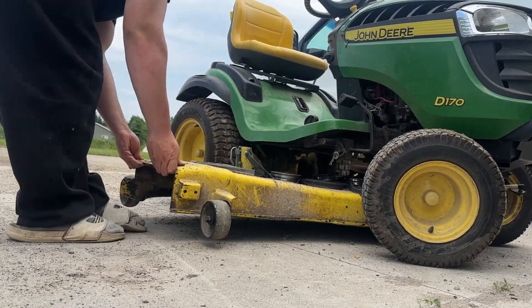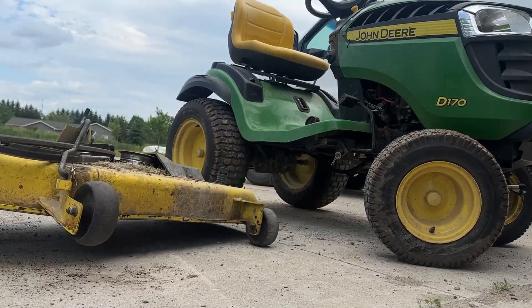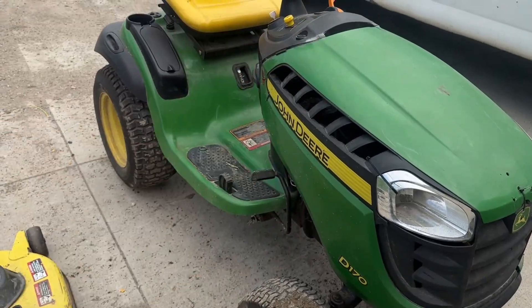When pulling the deck, please make sure not to hit the wheels and make sure to lift up the guide rod in front to make sure you don't damage any of the tie rods. Now that we've got the deck out, we can worry about lifting this mower now.